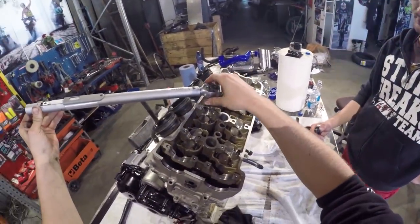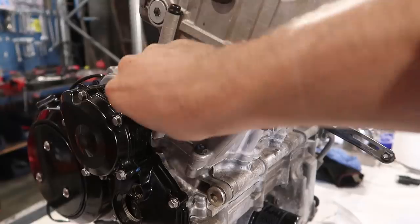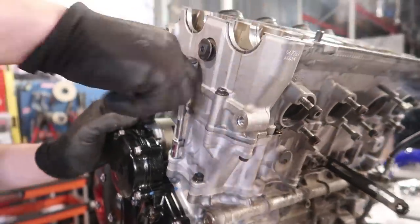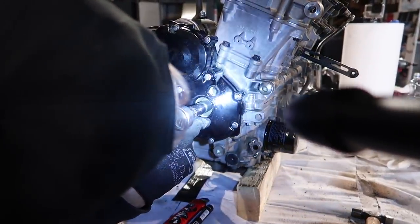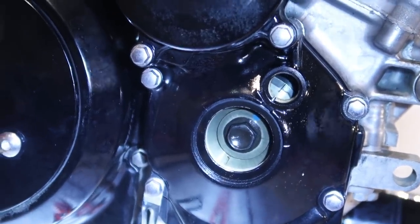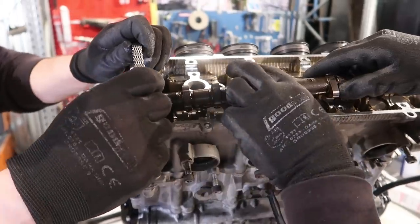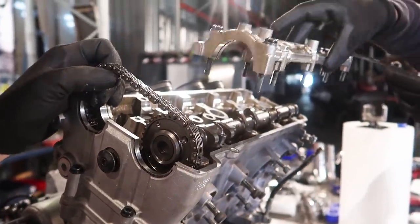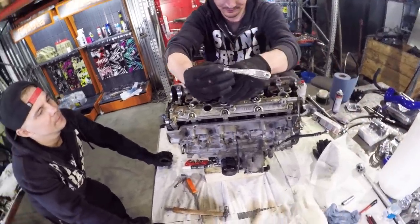Okay, that was the sound. These bolts also. And after that we need to turn the engine to the right position again. You can see the mark there. It's now good. Is it the right side? Yeah, exhaust side. The number one, the same level as before, same level as the deck. And then that one. Take the loose away first and then from the side to the middle again.